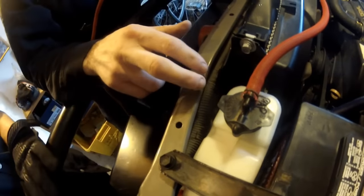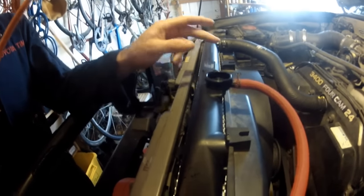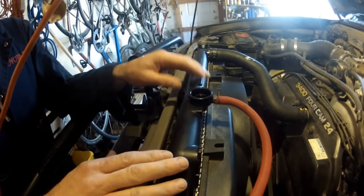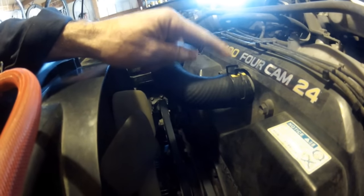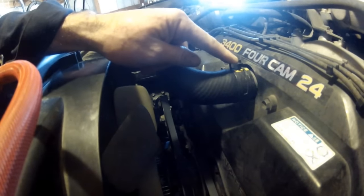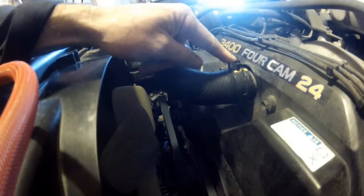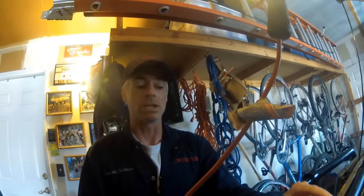We're starting off with an empty system right now. If you're putting a new radiator in, it might be a good time to renew your hoses too. If you're not replacing the radiator, at least take this as an opportunity to change your hoses if they're brittle and old. Keep these constant tension clamps — they're much better than the regular screw-type ones. From experience, the radiator holds about two gallons when you drain it.